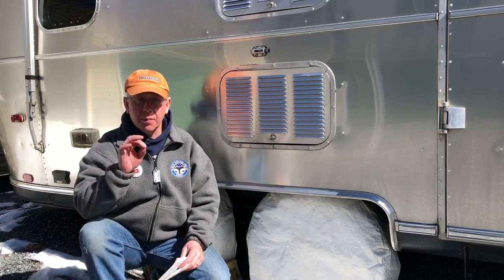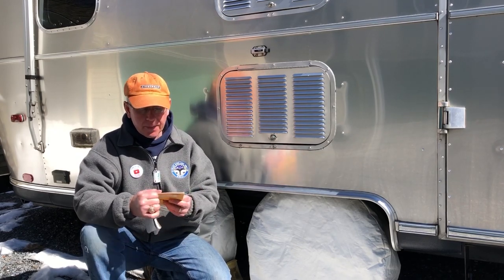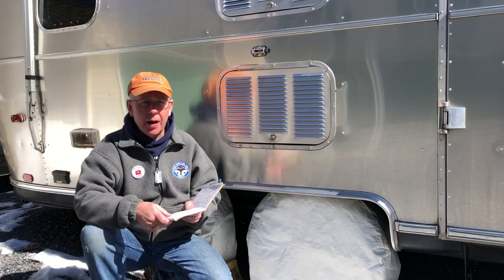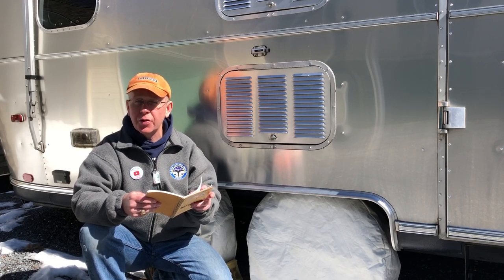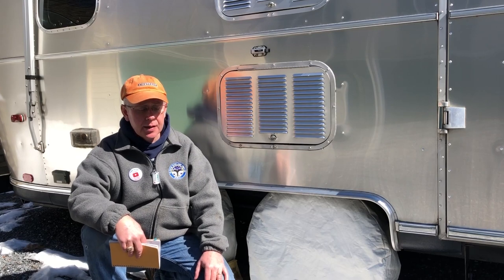This next item involves the wheel covers, though I'm not really going to take the pants or wheel covers off. It's to check the date of your last wheel bearing repack. An important part of any maintenance program is to have fastidious records. My wheel bearings were last repacked at 58,134.6 miles — I repack them every 10,000 miles, so I'm due at 68,134 miles. The Love Sub currently has 64,232.3 miles on it, so I've still got about 3,000 miles to go. Probably when we get back from our first trip we'll repack the wheel bearings — I'll have a video for that.